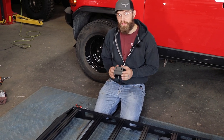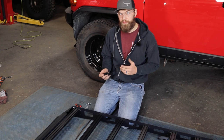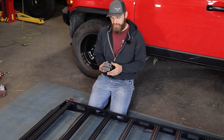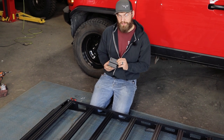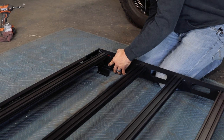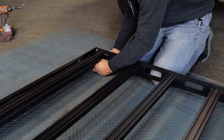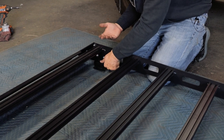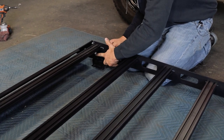At this point, we can go ahead and install the roof mount brackets to the side rails. They're easily identifiable by an F, M, and R cut in the brackets to tell you front, middle, rear. I'm going to go ahead and show you how to identify your lefts and rights as well. Right now I'm working on the passenger side, so I'm just going to make sure that my front mount angles slightly toward the rear of the vehicle, and that my round holes are facing down toward the roof, and the slots are actually where I'm going to be installing it to the side rail right now. For this you're going to be using the same three-quarter inch long hardware that you've been using all along so far. With the bolts installed, what I like to do here is just push the bracket down as far as possible — that way it'll raise the rack up as high as possible from the roof line, just to give you enough clearance when you're sitting it down on the vehicle that you don't have to worry about damaging your paint.